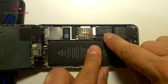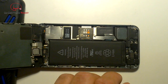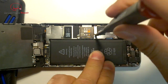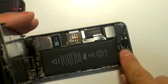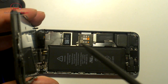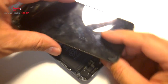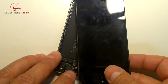Reconnect the battery cable and put the panel back inside. Then plug the flex cable into the bottom. Make sure your cable looks correct — it goes back here, over here, and this way again, so you end up with kind of an M shape when looking at it. That gives you the correct orientation inside the phone.